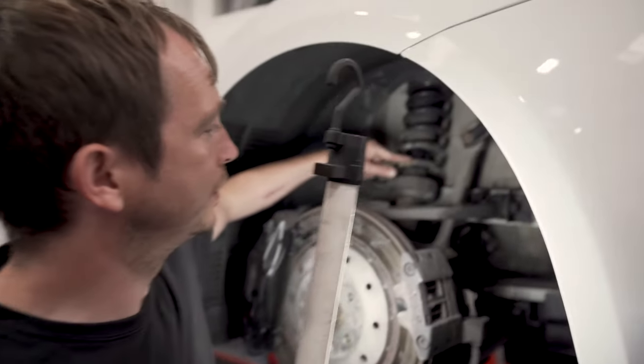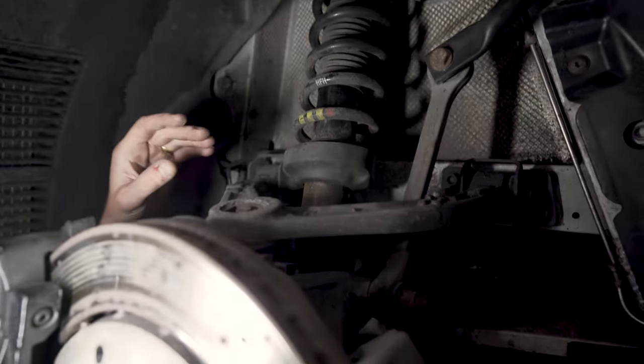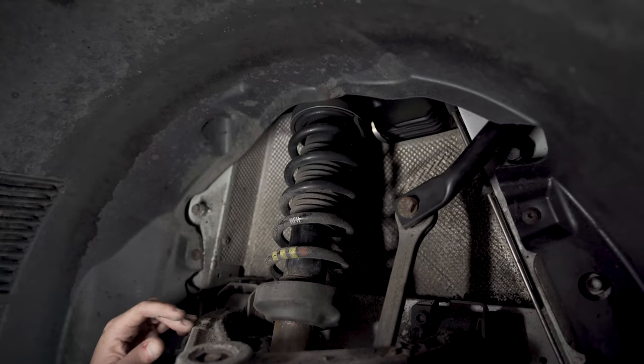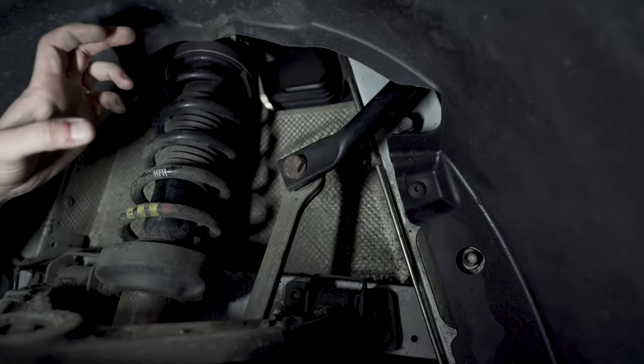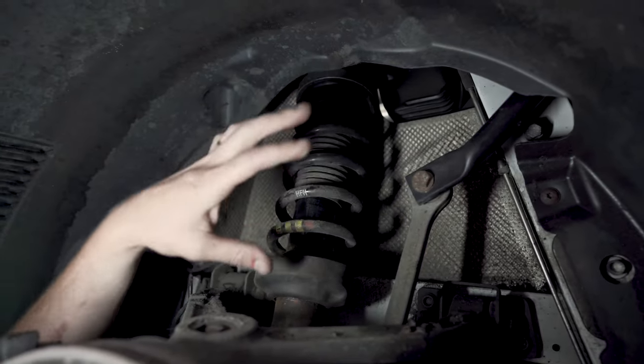These cause problems. We don't have problems with our upper or bottom arms. Never even done a wheel bearing, have we really? They're pretty solid on wheel bearings. We see people put the anti-roll bar links on back to front and you get funny noises. So they'll put the link over the top of the bar. I don't know how, because it's almost impossible to get the bolt in because of the angle it's at, but that's normally when it's had an exhaust.